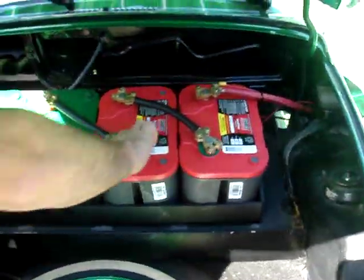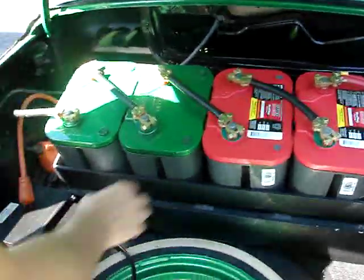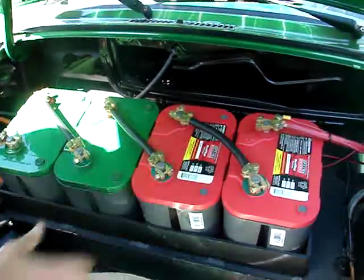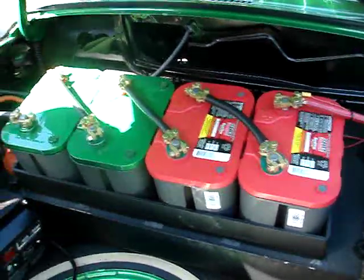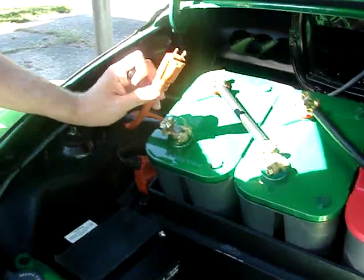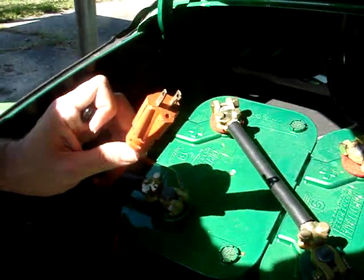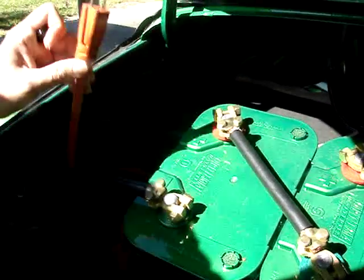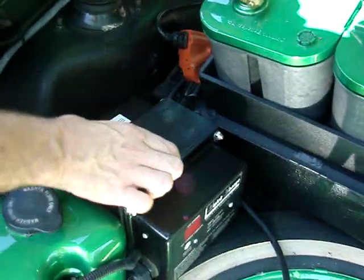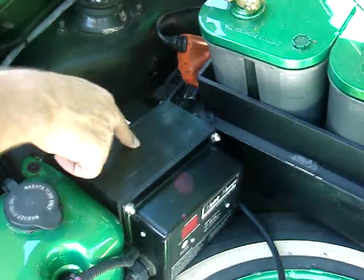None of it's dangerous if you know how to touch it right. I'm not getting barbecued, I'm not getting shocked. You don't want to put your tongue anywhere near this stuff for sure, but it's completely safe — I say it's safer than a regular car. This is how I charge it: it's just a standard power cable. You can hook it up to your standard 110 outlet inside, or even 220 — it'll charge twice as fast. That is connected to the charger right here, this 175-volt charger, and then it charges the battery pack.